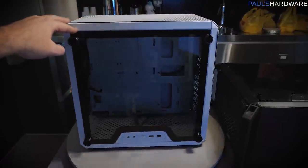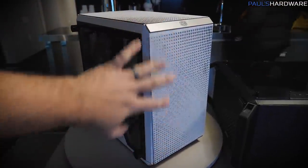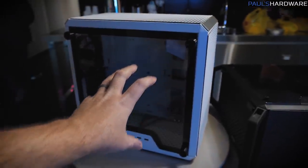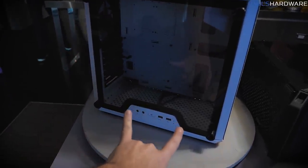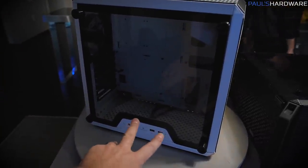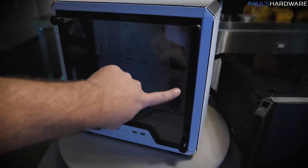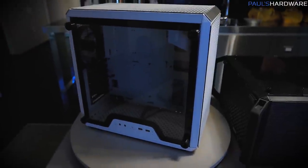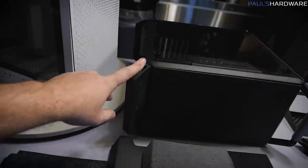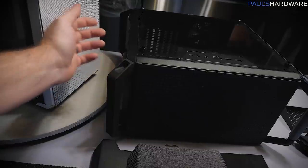These are super flexible. The original design had airflow coming in the front with lots of mesh, so there was tons of airflow, but putting a power supply up there does limit airflow a bit, so they've redesigned it so airflow can intake from the bottom and exhaust at the top. The side panel is rotatable, so the I/O — which is part of the side panel — can be moved to the front, top, or even the back. If you're going with vertical orientation, you'll want to add handles so it sits up off the ground to allow airflow intake at the bottom.